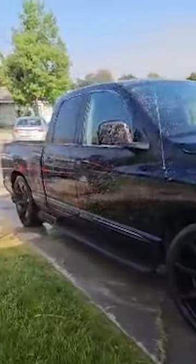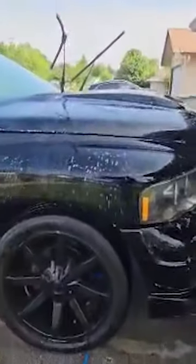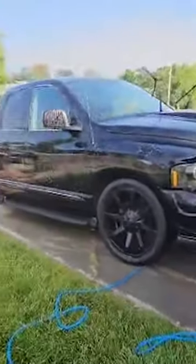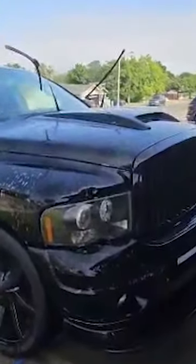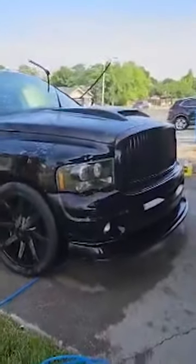We are on site right now. I got Caleb here spraying some APC on this vehicle — there's a Dodge Ram. The owner said he kind of uses it as a track car, a burnout competition vehicle and everything, so there's definitely some rubber stuck to the back fender wells. We're just trying to break everything up really quick, then come in with the foam wash to break it up even more, then we'll hit it with a clay and seal. After that we are going to be doing a test panel on the client's other truck to see what we can accomplish for a two-step paint correction.